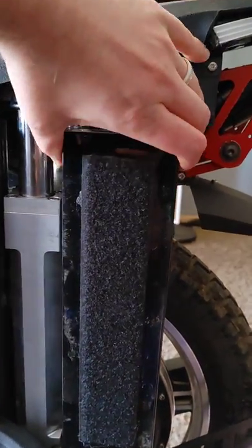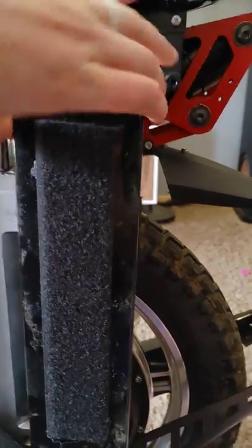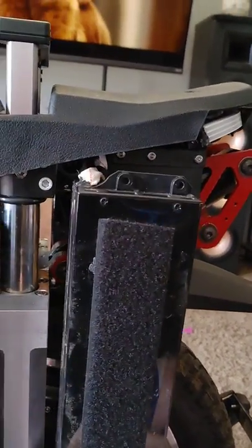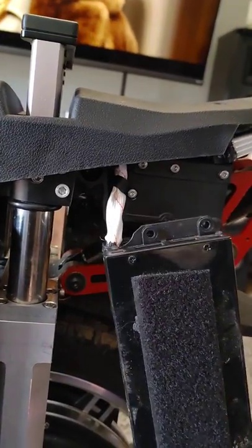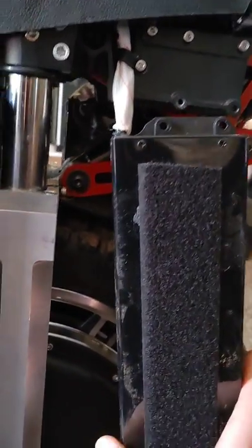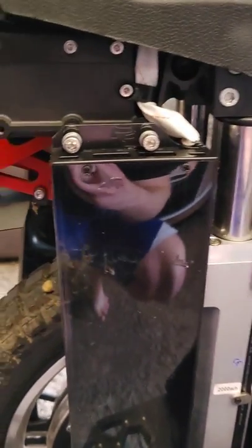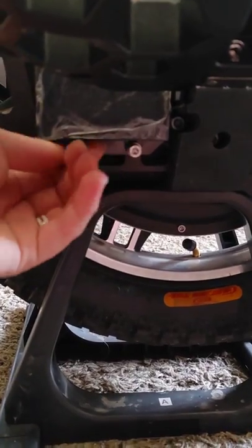You want to remove those two bottom screws and the two top screws at the top of the battery pack, and then you could lift it out and upward, and it pops out. I rested mine on the pedals, not to create stress on the wires. But that is the bottom shock attachment — this side is the same, four screws, and the battery pack just pops out.